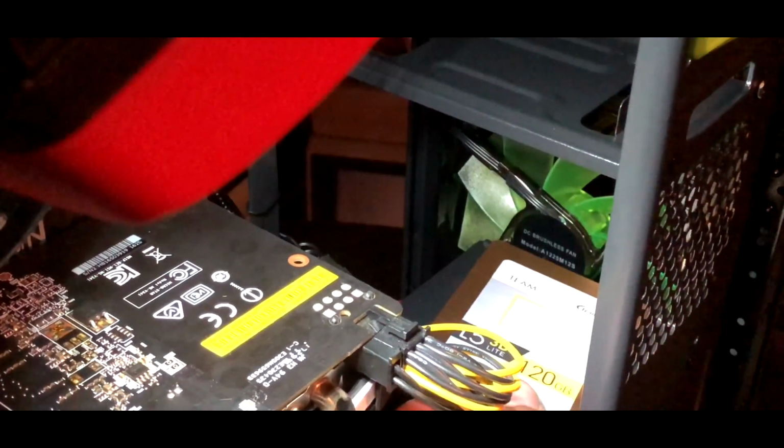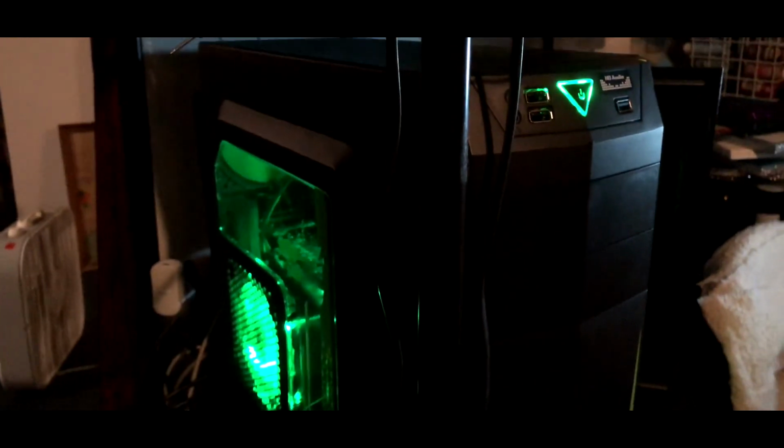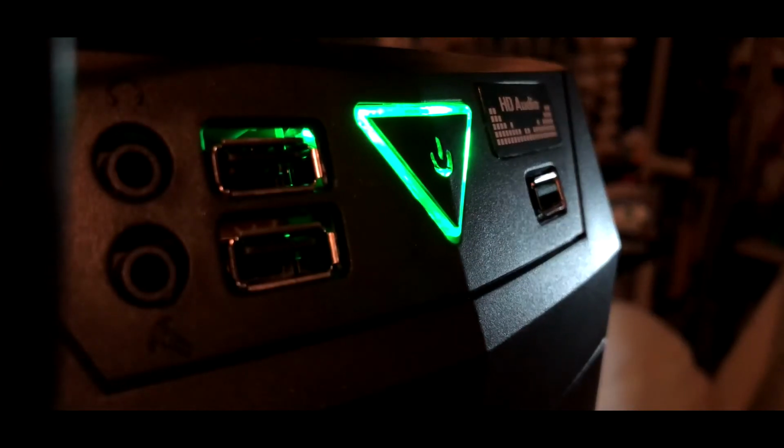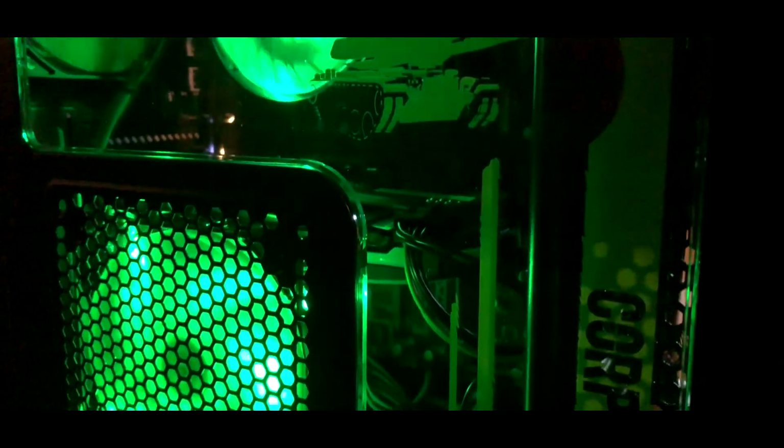Everything for the most part was pretty easy to put together inside the case. The SSD fit just fine, as well as the hard drive in those hard drive bays. One thing I recommend doing when you're done building any PC is using a small piece of electrical tape to put around the front panel connectors so they don't have a chance of getting loose, and it's easy to plug them back in again since it'll be one connector instead of a whole bunch of individual header connectors. Now that we're done, we can zip right into the benchmarks.